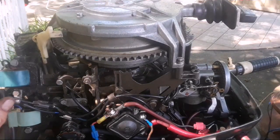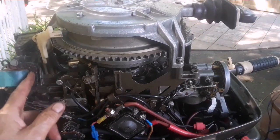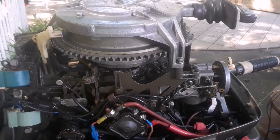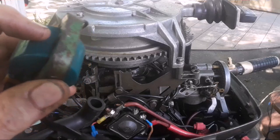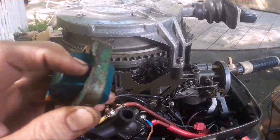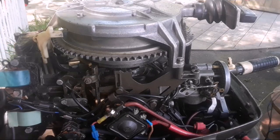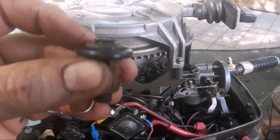If the cracks aren't near the ground you can usually get away with it, but when you get a crack that's right near the ground you've got to change your coil. I thought about possibly doing marine tex, but I'm going to tell the gentleman to just buy a new coil — he could put it in himself and keep this one as a spare or until it goes. I'm not going to guarantee an old coil like that. It's about $30. They also yanked out the thermostat, which looks okay.